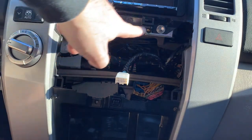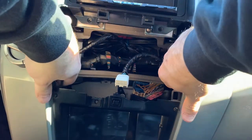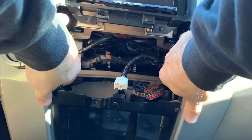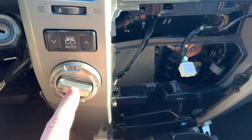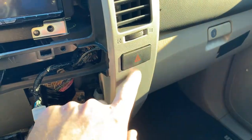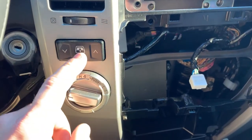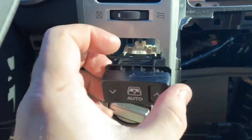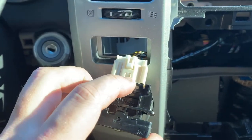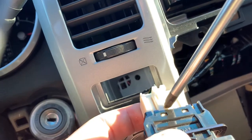You'll have two bolts right here underneath the radio — unbolt those — then grab here and here and gently pull, don't go gorilla. The three things you'll have to unplug are the window up-and-down switch, the four-wheel drive, and the hazards. Quick tip: if you can't get the clip off the rear window switch, go to the back and push it forward with your finger — it'll shoot forward. Then put a small screwdriver on that little tab and push it right out in the center.